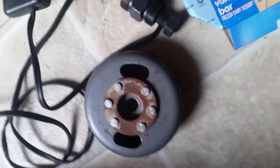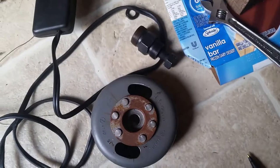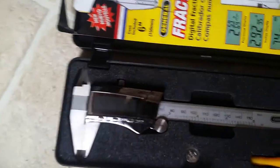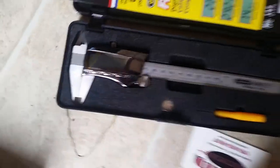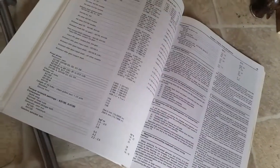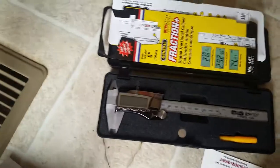My trick is this: I take business cards, just a regular business card, and I measure it with my caliper. I match it up to the specification in the book. I have a bunch of different size thickness cards for different size gaps. So I found one that was the same size as the feeler gauge. Then I cut out a strip and cut a little square off of it.